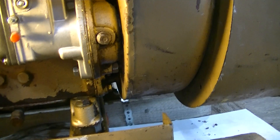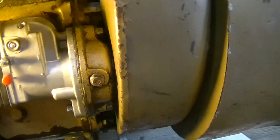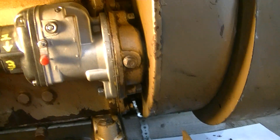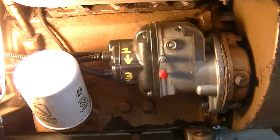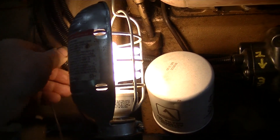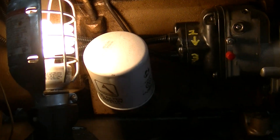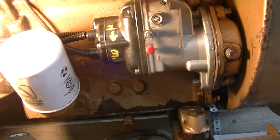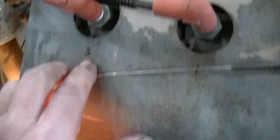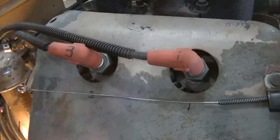There are no other adjustments — you can't advance or retard it a few degrees; once it's fastened, that's it. I put new spark plug wires on and used plastic loom protection. I ran them on the outside rather than through the original housings. Looking from the front of the engine, number one is here, number two is directly across on the other bank, number three is next, and number four is the last one on that bank.